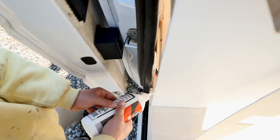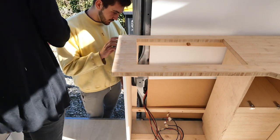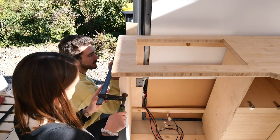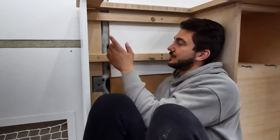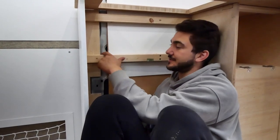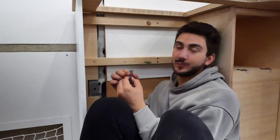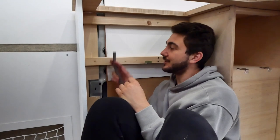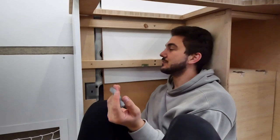For now we're just going to put in that panel and then we might actually be ready to screw that part of the kitchen in. To close the gap between the back wall of our kitchen and the van itself — there's about a centimeter — I found these foamy snake pieces that you can basically jam into the gap to close it up. Then if you want a nice outward-facing finish, you can just silicone over it. So that's what we're going to do here.